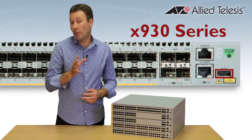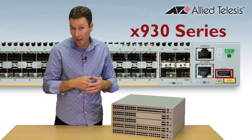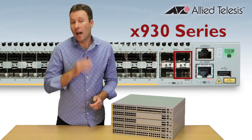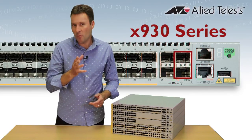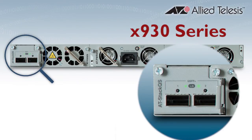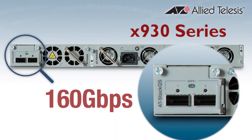Software releases, configuration and other files can be stored on the USB for backup. You can use two of the uplink ports for stacking, providing 40 gigabits of stacking bandwidth. For even more stacking bandwidth, a rear port stacking module provides a massive 160 gigabits per second and leaves all four front panel 10 gig ports free for network connectivity.